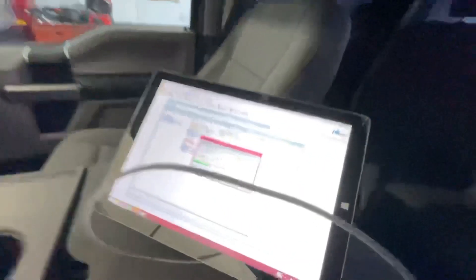There's a little tip I want you guys to see when you're flashing your tune. It should only take about 30 seconds on a 2018 and newer F-150. So if it's taking three minutes like you see here, you're going to have to reflash the truck — it basically means it didn't communicate properly with the computer. If you're doing a write calibration on a 2018 and newer F-150 or Mustang and it takes three minutes, rewrite it again. Don't bother trying to drive it — it's going to drive stupid. It should only take about 30 seconds.